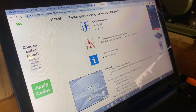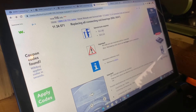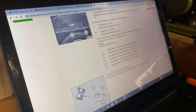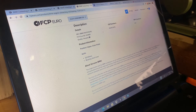I was having problems finding exact specs for my crankshaft — I wanted to see where the OEM clearances and tolerances were for the rod journals and I couldn't find anything on the technical spec sheet or anywhere online. I'll keep digging. I used a reference website that's helpful for finding clearances on other motors but couldn't find anything for the N54. My best option was to go to FCP Euro, where I've ordered quite a few parts, and check the bearing notes — they usually list sizing for journal sizes.